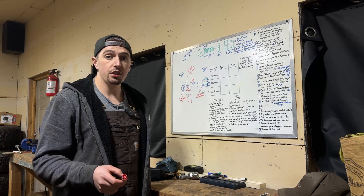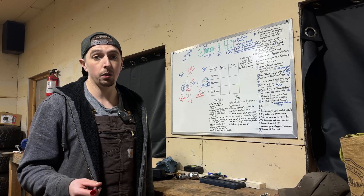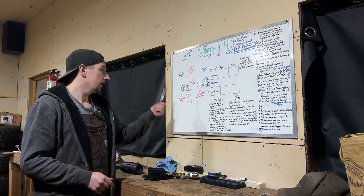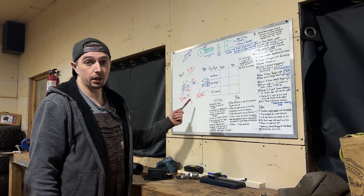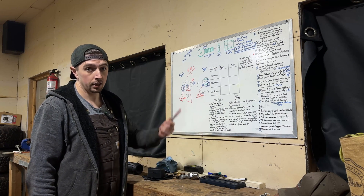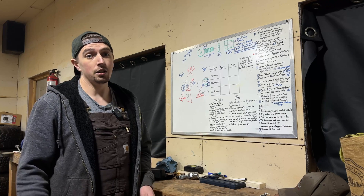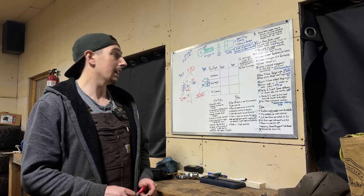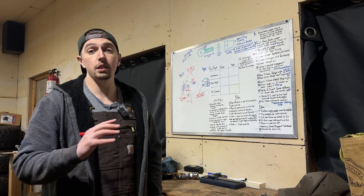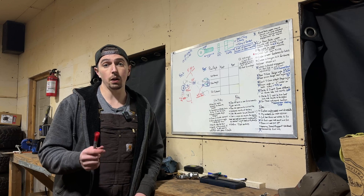I want to find a relationship between my caster angle and my pinion angle, which lets me adjust while actually driving and fine tune it. What I found is that for six degrees of caster on a 1983 Toyota front solid axle, that correlates to four and a half degrees for the pinion pointing upwards. So I can use that relationship — if I drop the pinion by two degrees, that increases my caster angle by two degrees — meaning I no longer have to tear down my axle housing in the future; I can just reference those numbers.